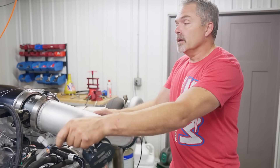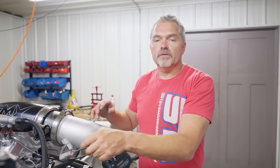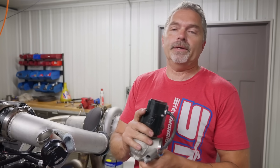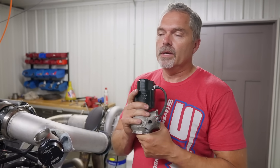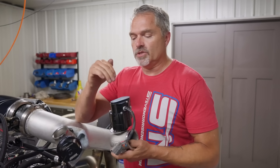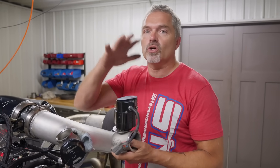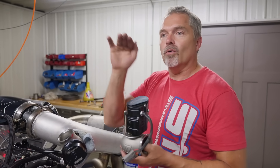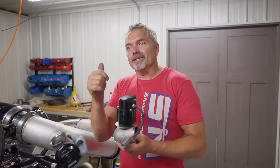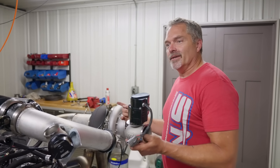So now we're going to wire it in, and I'm going to get with FuelTech on the phone and see if they can give me a hand setting this up because I haven't set this up before in the software. So it turns out that you can't use an electronic wastegate. I just was off the phone with FuelTech and they go, no, the neutral position of the electronic wastegate is closed. And it opens when it makes boost. Well, I need it to be open to get the turbo spinning so I can then close it as it's making boost.